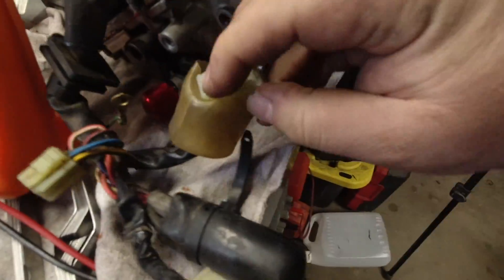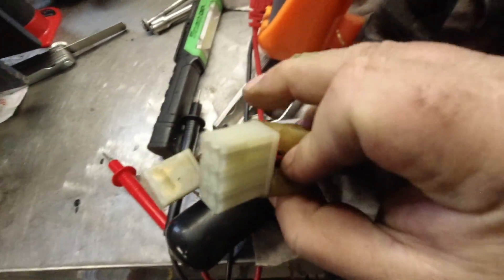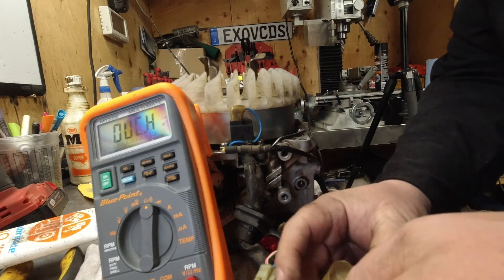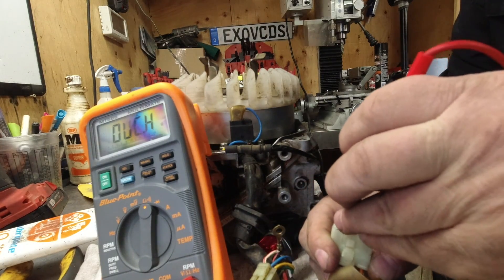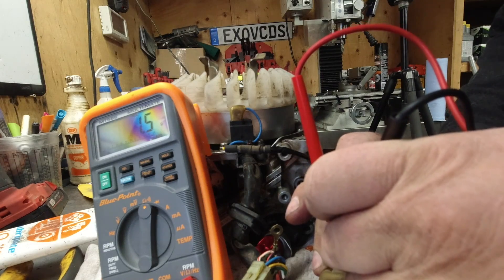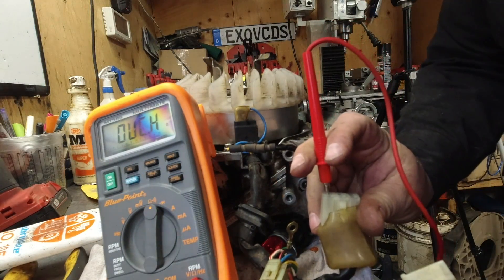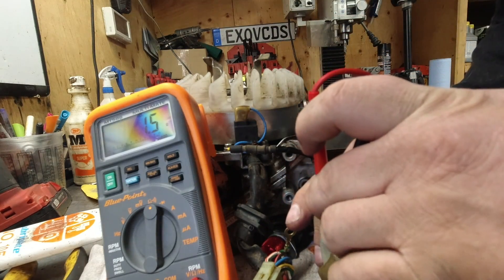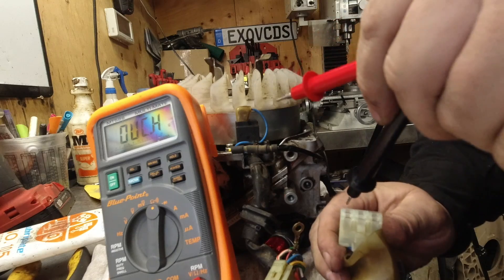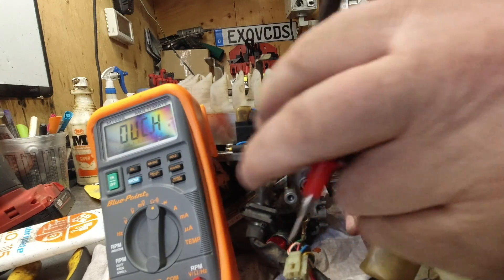On the big plug there are three wires we're going to be testing: red, white, and blue — red and blue on the ends and white in the middle. The first test is red and white, and our value should be 1.415 ohms — we're at 1.5, so we're right in spec. Next test is between red and blue, and we should be at 1.415 — and that's what we're at, 1.415, we're good. Finally, white and blue on the big plug — the resistance value should be the same, 1.415 — and we're right in spec. AC coil test is good.